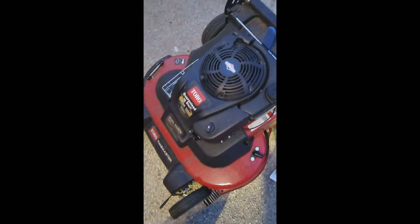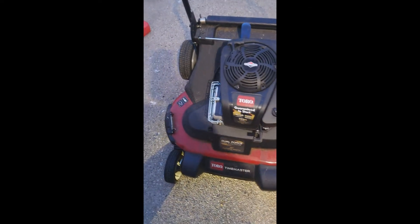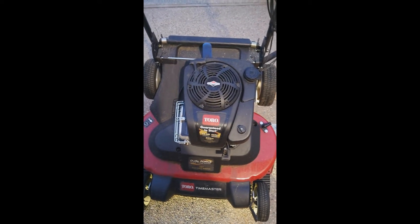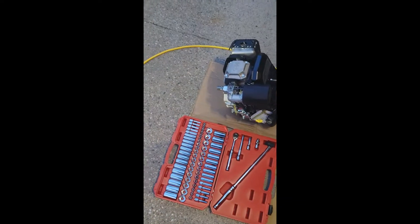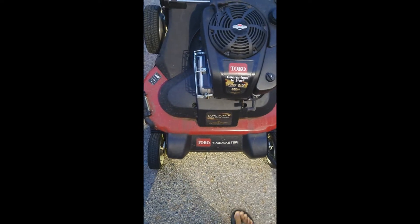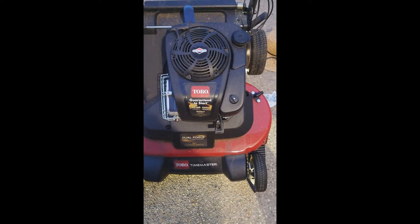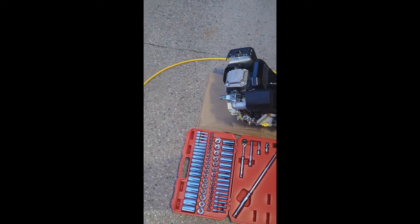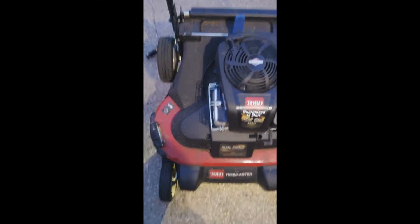Number one, because I can. Number two, this engine just flat out sucks. I know this is an upgrade to the old engine, but in my personal opinion it's still underpowered. You have two blades under there and the thing is bogging down. I've done a lot of research and seen that when they put the Command Pro on, even with tall wet grass it just doesn't bog down. Also, this engine keeps surging. I could adjust the carb but I just want something with more longevity that I don't really have to bother with.